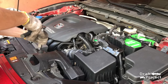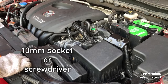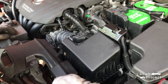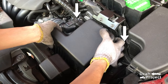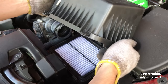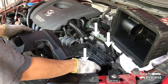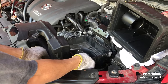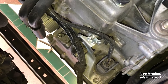While draining, remove the air intake box assembly. These are 10mm bolts — you can use a socket or a screwdriver. Push aside the metal clips on both sides. Remove the air filter. There are 3 rubber grommets that hold the intake assembly — just pull the whole assembly gently. And there you can see the dipstick.